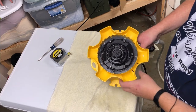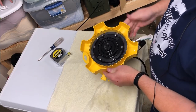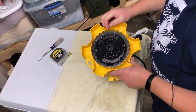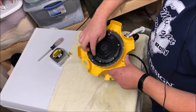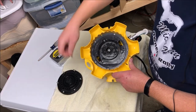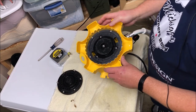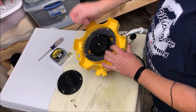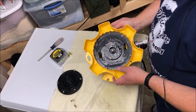I've had to service this thing a couple of times in the seven days I've been using it, and it was really my fault — I was pulling out my shop vac and there was some cat hair that got stuck in here and inside the impeller. To clean it, undo these six screws — I've already pre-loosened them — then lift this thing up and off. Here's the impeller area; you can see there's cat hair and some gunk in there. I used a pipe cleaner because there are little openings you can push it through and pull debris out from the middle.